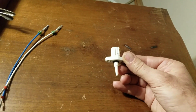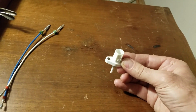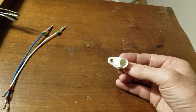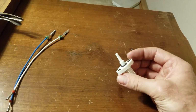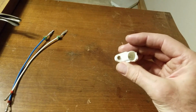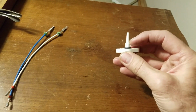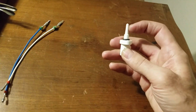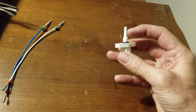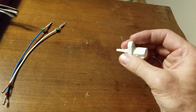I can't put it next to the air cleaner before the turbocharger, because the intake air after the turbocharger changes dramatically. And it changes really fast too. So this sensor I think I got from an Accord. This plastic that's on here is going to make it read too slow. So there's a resistor that's underneath this plastic. I'm going to want to cut it out and get to it.